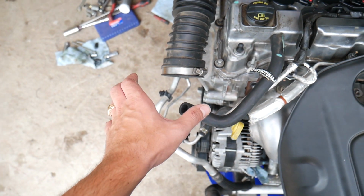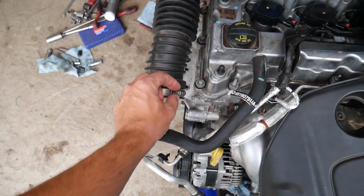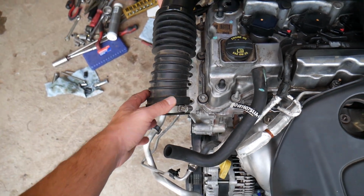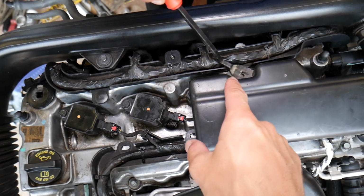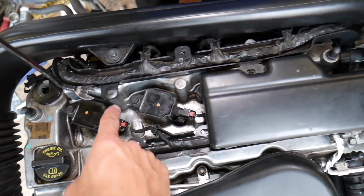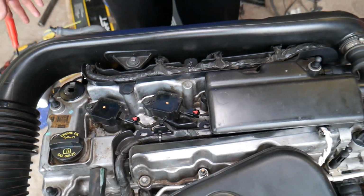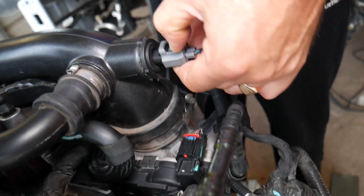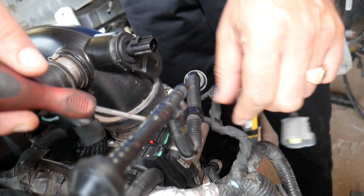We have your air filter box here. When the engine is in the car, get that hose clamp loose and get that hose out of there. Now, here you will have one clip right there. Our clip is broken, but it will be just like this clip, so you go underneath with a clip remover tool and pull it straight up. You need to disconnect your intake temperature sensor there, and after that, you need to get the hose clamp loose for the throttle body.